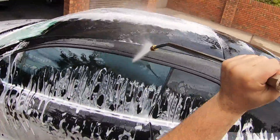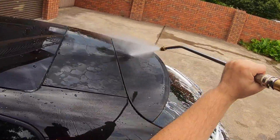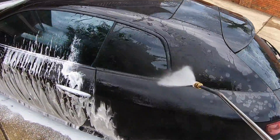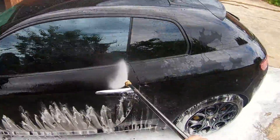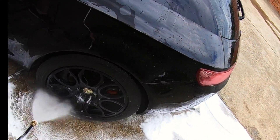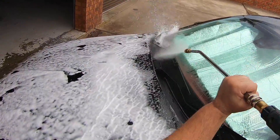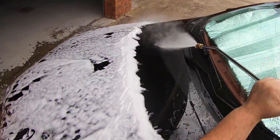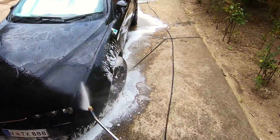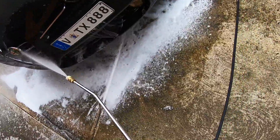That aside, not all products are simply black or white, and Super Resin Polish is one of those gray area products that since its release has spawned many more products in its category, which would be generally considered as an all-in-one polish. All-in-one polishes correct car paint defects as well as fill minor imperfections and protect the finish all in one step. But compared to what we consider as an all-in-one product today, Super Resin Polish is a little different, and I'm pretty sure that compared to the first bottle I ever bought, the chemistry of this product has also changed — becoming less of an abrasive compound and more of a solvent cleaning product.